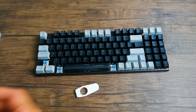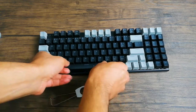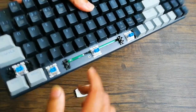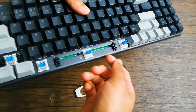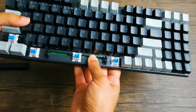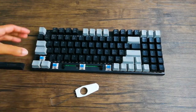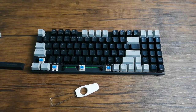For the spacebar, I don't use the tool — I use my fingers. That's why I took off the two caps on the side, so I can get my fingers underneath and just pull straight up. As you can see it came off pretty easily. This one also had three connection points, so that's why I do it from the ends so I'm not breaking it — if you were to pull from one side it might bend or break the cap. But overall you shouldn't be too worried. Hopefully this was easy to follow. If you need a better explanation or want me to take more caps off, let me know in the comments and I'd be happy to make another video. See y'all next time.